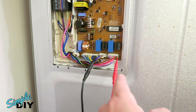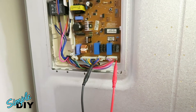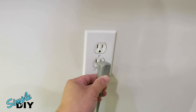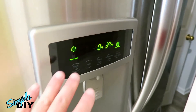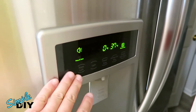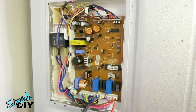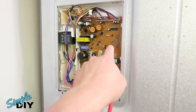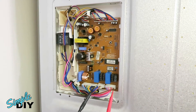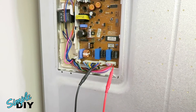Be very careful — the output is 115 volt AC, so make sure you don't touch a probe or you'll get electrocuted. To do the test you will have to plug the power back in. With the power cord plugged in, the fault will clear and the display looks normal. Press the switch once to enter test mode. In test mode number one, the output to the heating element is off, so we're not going to get the 115 volts we're looking for.